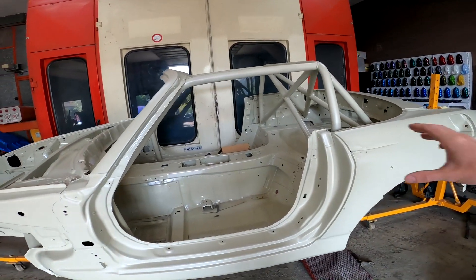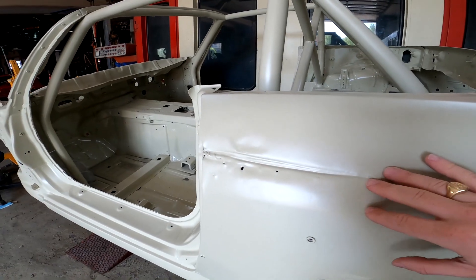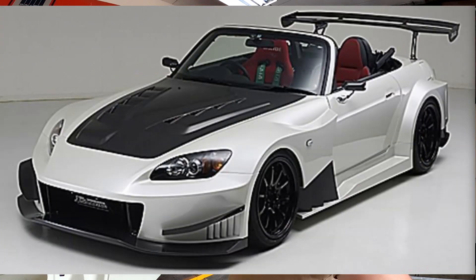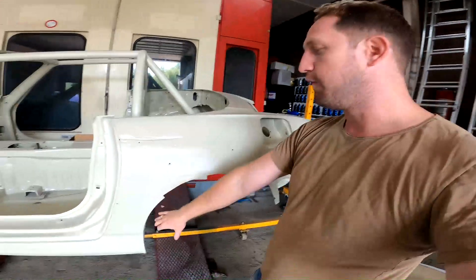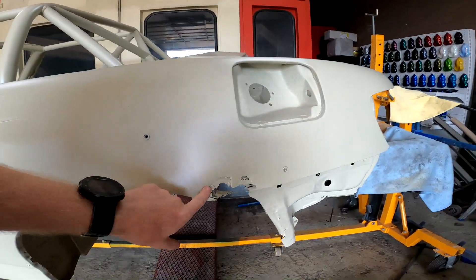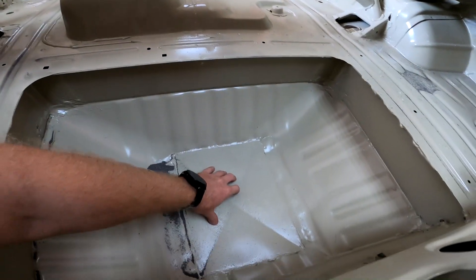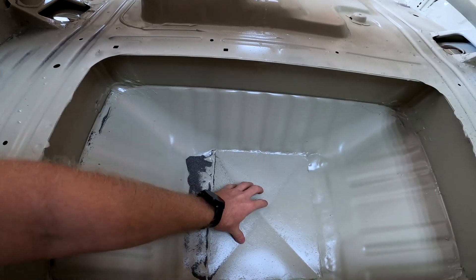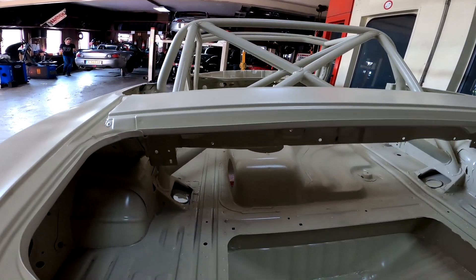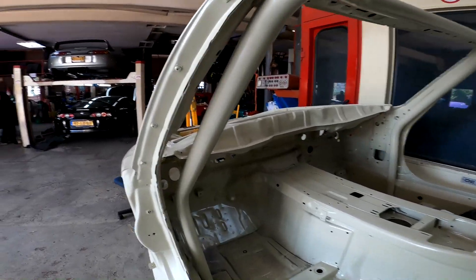He's also done the rust repair on the chassis. Everything has been sandblasted and you can see this beautiful epoxy coating. We still have some old damage in the car that was previously hidden by the overfenders, which is going to be cut out when we eventually get our Type GT Jay's Racing Y body kit — so not to worry about those details. This whole fender is going to have to be cut out to make space for the bigger wheels we're fitting. You can see the old rust on the chassis that's been sandblasted out and covered with epoxy coating. There was damage in the trunk — the entire trunk floor was actually rusted out — so that whole piece was cut out, and a new piece was welded in with epoxy coating. The whole chassis looks really good now, basically as good as new.